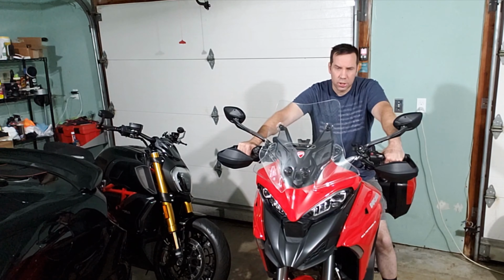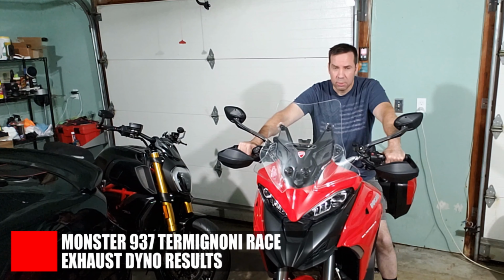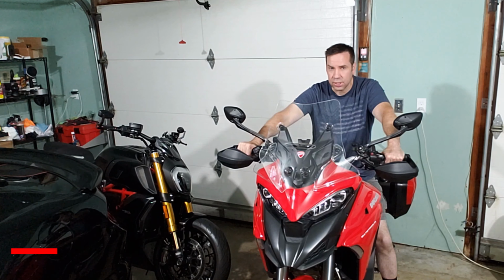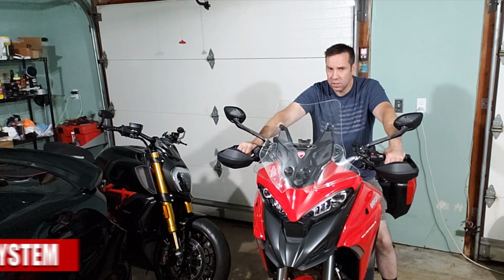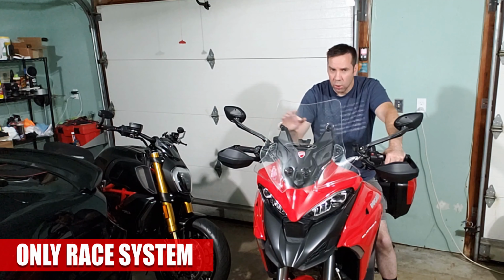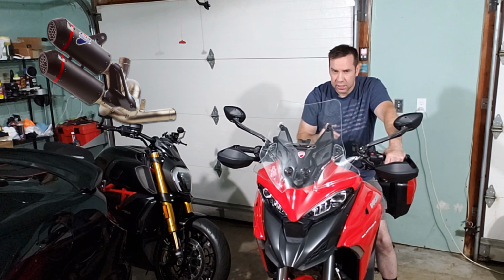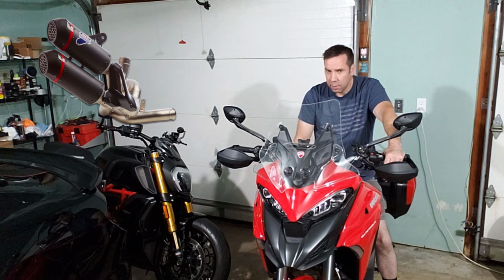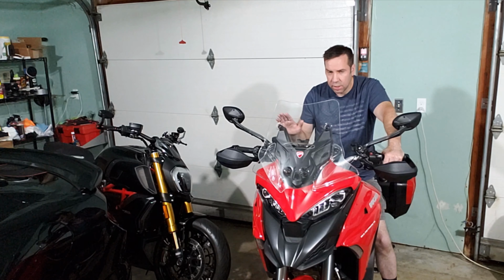So in this video, we're going to share a dyno with you and let you know what you can expect in terms of horsepower and torque for the Monster 937 with the full Termignoni race system and the DB killers out. So some things to keep in mind here. This dyno does not apply to the Termignoni slip-ons. Only the full race exhaust with the DB killers out. The full race exhaust, as you know, includes the up map, which also frees up some of that power and torque for you. So what you see here, you're not going to see with the slip-ons.